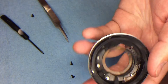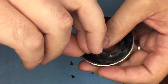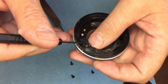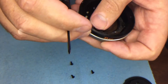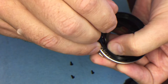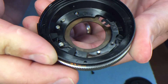The final step in this section is to take the stronger, thicker spring and install it over the long arm. The long arm goes to catch the button. Be careful that it doesn't fly out — it's very easy to lose. It's a little difficult to work with here. Once it's on, when this rotates it controls the aperture position.